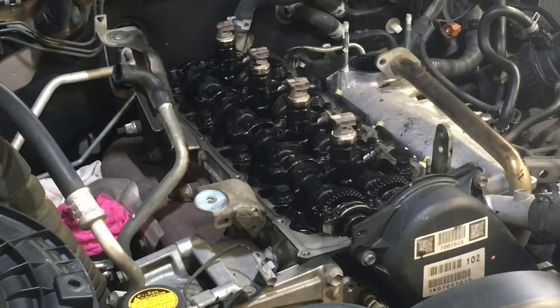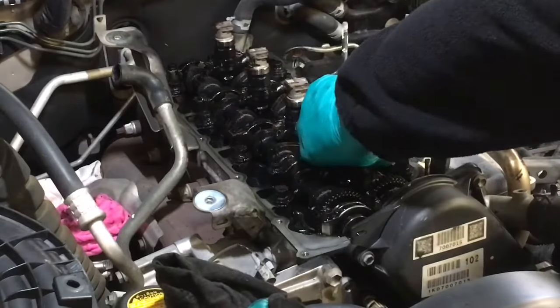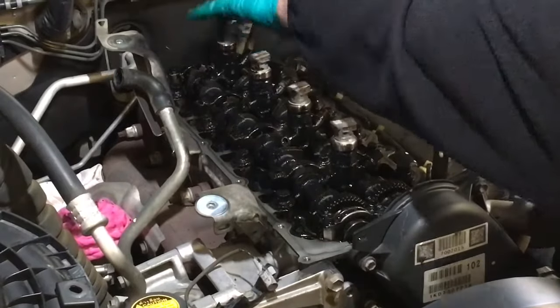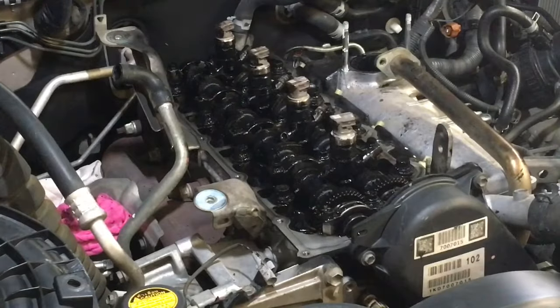Okay. Now this is the important part. This is where you get to see which ones have got the blow by. The seat's leaking, the mess everywhere. Okay. Who's gonna put their money on number one? That's stuck. Two twists, that's good. Three twists and four twists. So number one could be an issue.